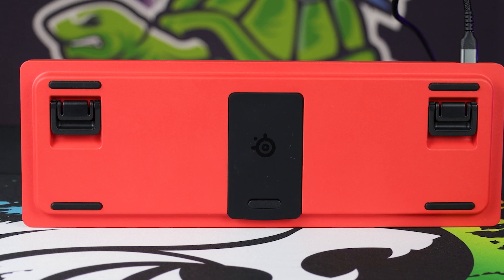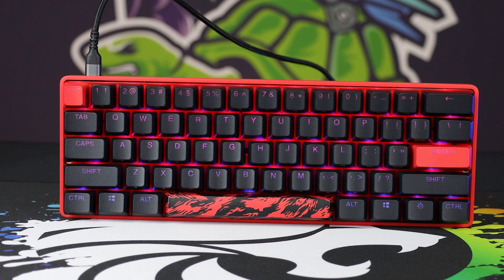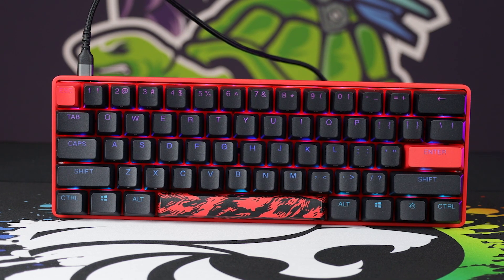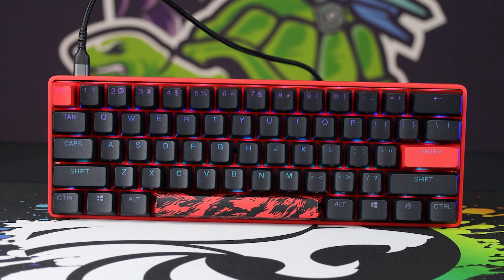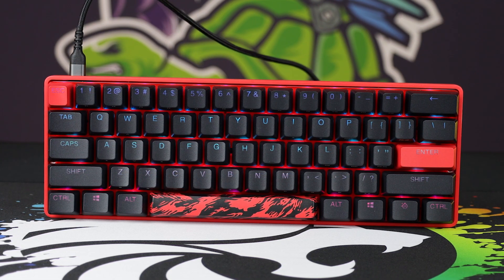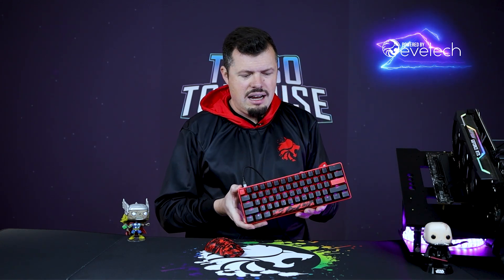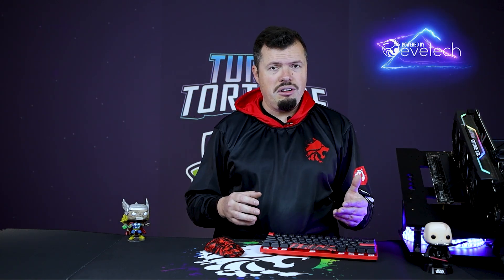The fact that you can put it on either is quite nice. And you can replace the switches if any of them get sticky or have problems. The only criticism I have for the keyboard is the plastic backplate. It does give it a little bit of a plasticky bottom out. It doesn't have the thock that we sometimes look for with full aluminum construction. But it is considerably lighter — it would be very good as a tournament keyboard. It is quite rigid as well because inside there is an aluminum plate in the base of the keyboard. I would also like a little bit of lubrication. But the double shot PBT caps are really nicely finished, like the tiger stripe spacebar, and the overall look and feel is very much in line with the brand.